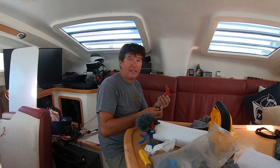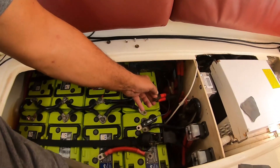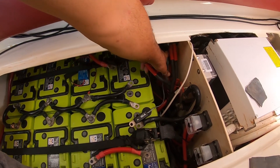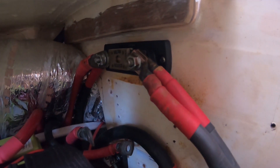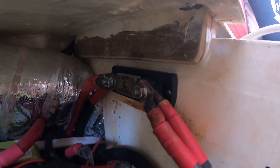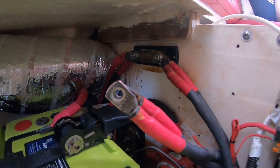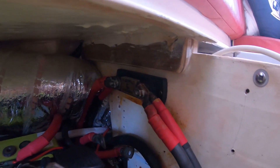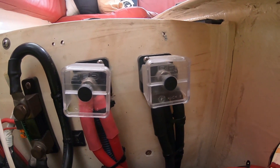I had not intended on taking all the fuse holders and everything apart but this whole assembly was absolutely black. I've cleaned up the cables a little bit and I've got to sand them some more. On the other side — which is really hard to get in to see — I have to clean up these cables and the fuse block that goes in right underneath. The cables are very black and the fuse holders are very black. I don't know if it was some protectant that was put on and discolored or if it's just corrosion, but I'm going to clean them up and sand them back a little bit so that I get a nice clean solid connection.